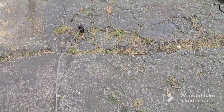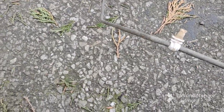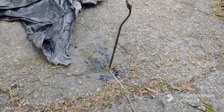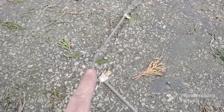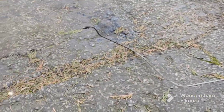Here's the right front brake line — I did the left front already. See the clips? I pulled it out. It's got a few bends, nothing horrible. Comes across the front of the car and goes up into the proportioning valve. I just don't know which side to start at. Maybe I make these two main corner bends, push it through, and then work under the hood.